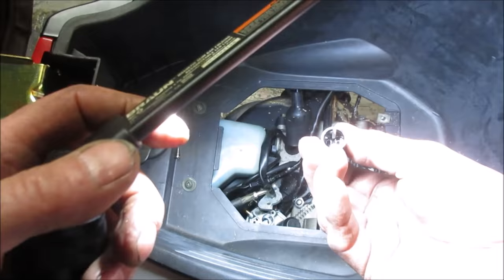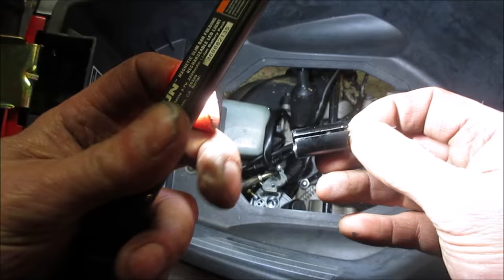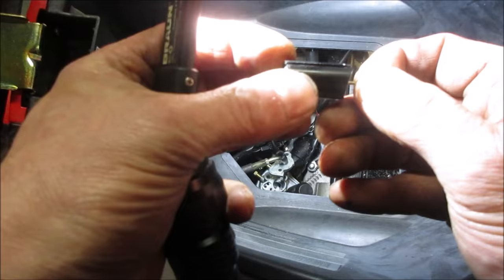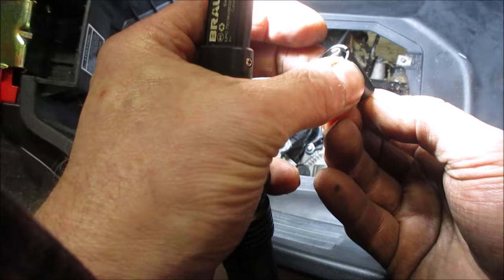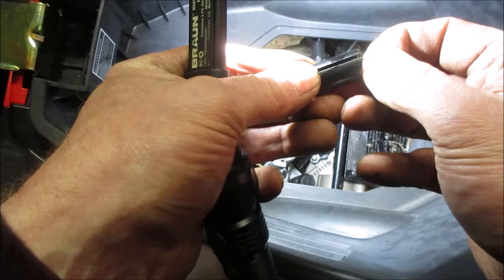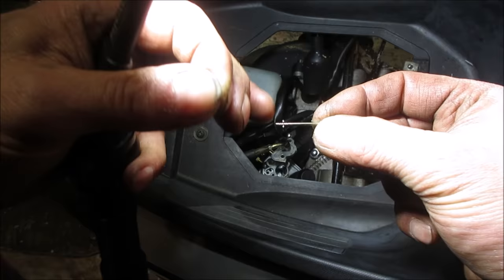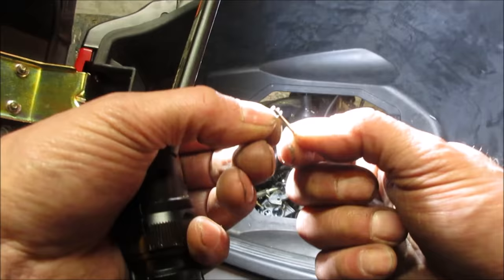This pin has positions it can go in. Seems like it might be right. Looks like it's on the middle one. So I'm gonna lower that pin so it gets a little less fuel, a little more air, and see if that four-stroking goes away. If the four-stroking doesn't go away, then I'm gonna say it's just damage that the CDI got.